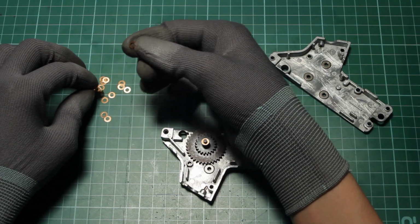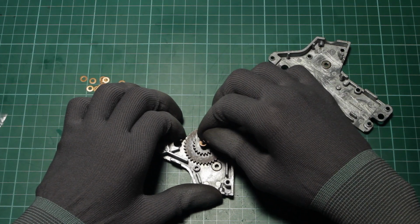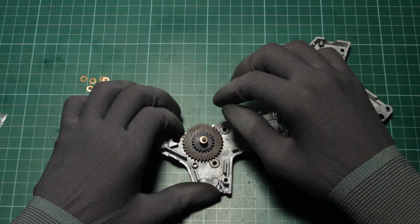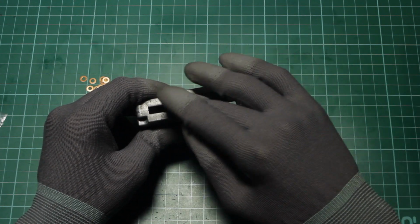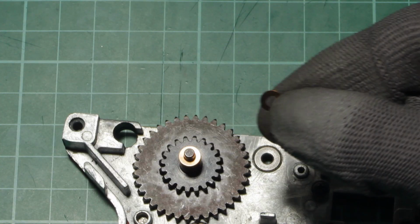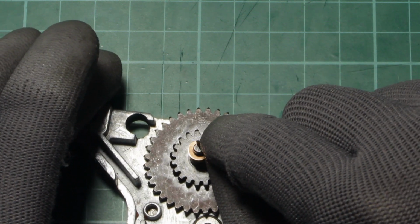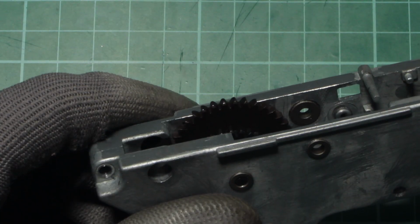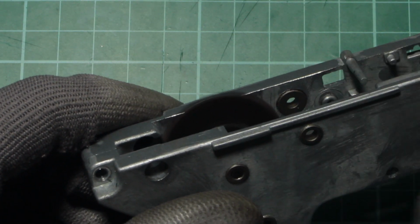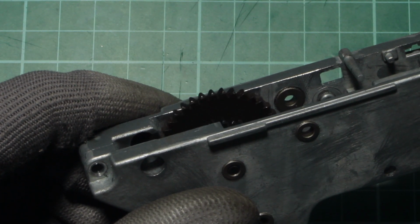If the last shim is too tight and begins to drag on the spur gear, it will prevent it from freewheeling. If that is the case, I will then remove and replace the last shim with a thinner one and try again. Eventually, you will strike a balance between play and freewheeling. You can again close up the lower gearbox shell and install the fasteners to make sure the clearances are just right.